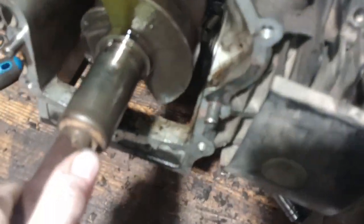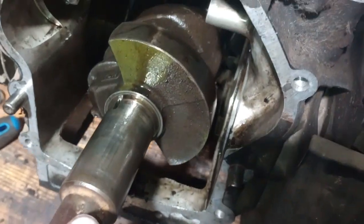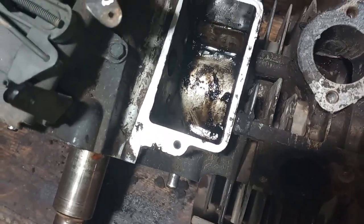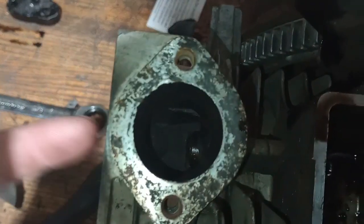I am not going to be using this crank - I'll show the new one in a little while. This valve, and that one, they're not so bad, but this one here has been blowing by - got carbon in the valve pocket that needs to be cleaned out. This is the worst side. The cylinder looks alright though - no real scoring, nothing deep, ring ridge isn't bad. We'll just get that honed.